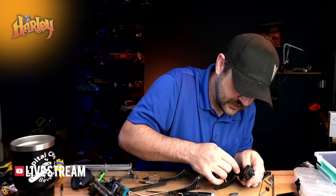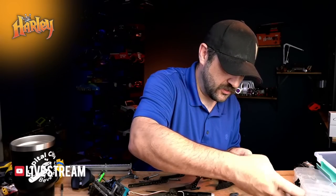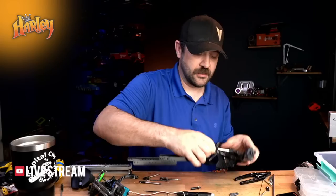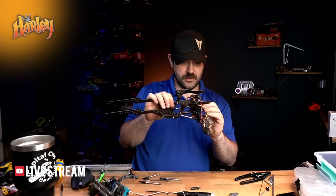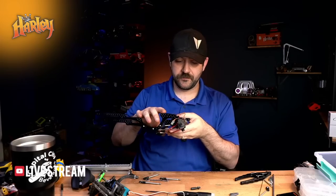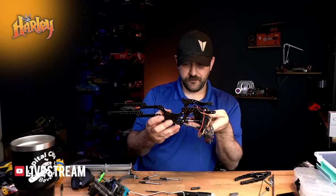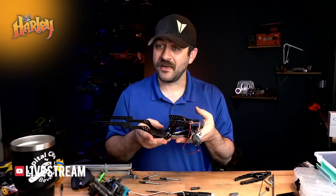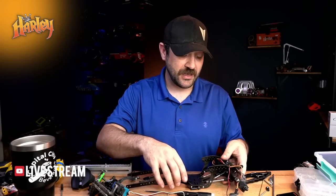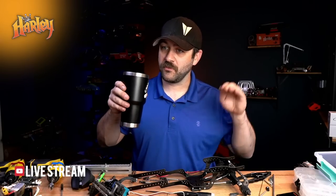See what this looks like. I feel like maybe a little too much caster, but it'll give me something. It's a lot of caster, but I feel like I can roll with it. If it was the rear, it'd be a different situation. I'll definitely adjust before the final links, but that's okay. I feel like I'm in a good enough spot at this point where I can accept it and move forward, which is our goal tonight. Move forward, move forward.